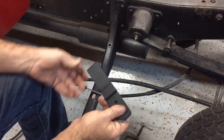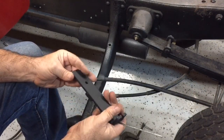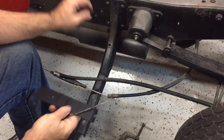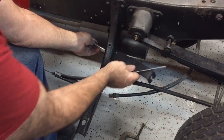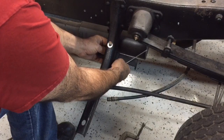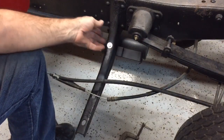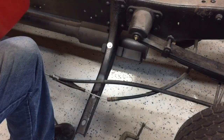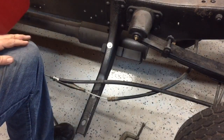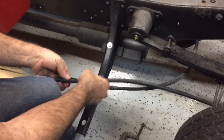I changed my mind on how I'm going to attach this bracket to the truck. Instead of welding it on, I've welded this little stop on here. There's a hole in the support for the running board, and I'm going to just bolt it on here. This little stop will keep it from twisting. This way I could unbolt it — if I need to make any major adjustments for the length or whatever, I could redrill it. I left a little bit on the tag end of this bracket so I could move it further back. That's going to be how this sits in here.